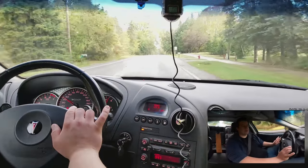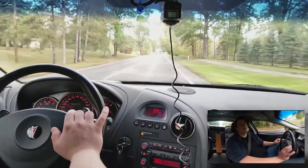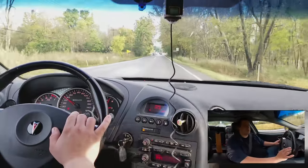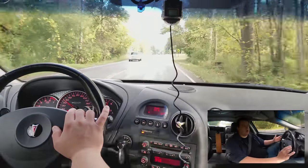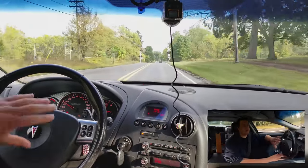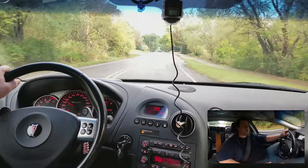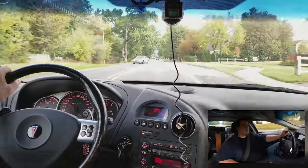I know it's not something in the steering — the cotter pins are still in there and everything's tight. The control arms are brand new; I replaced both of them when I had my engine out. Since the noise happens when I turn the wheel, and control arms don't turn left and right — they move up and down — I don't think that's what it is. I can reproduce it when I'm turning the wheel from a stop.